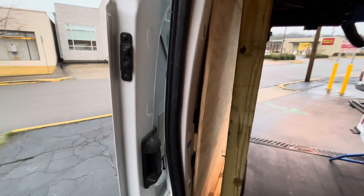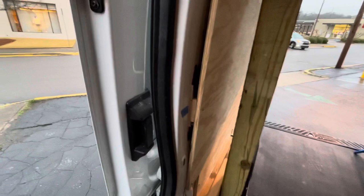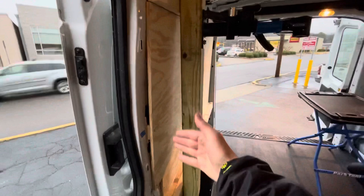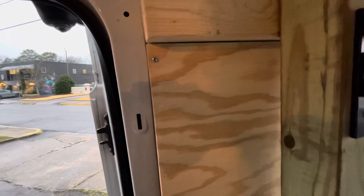This gives a good view of some of the craziness from the last video with the curvature of the walls. The span between frame points is maybe 16 inches — if you think about stud spacing in a house, it's about like that — so you don't have to get every little gap filled up. I used a straight edge to find the biggest gap and made a series of wooden and rubber shims, and you can just drill straight through — that thing's solid.